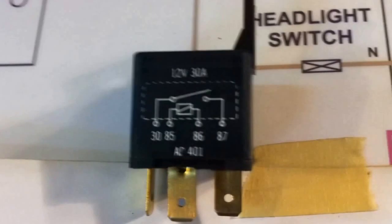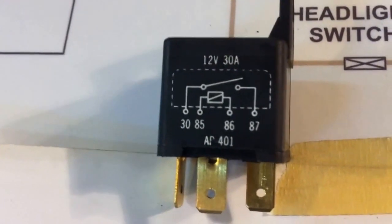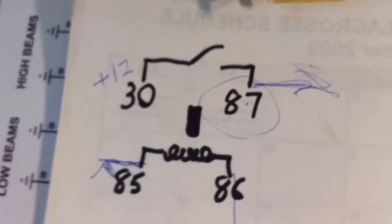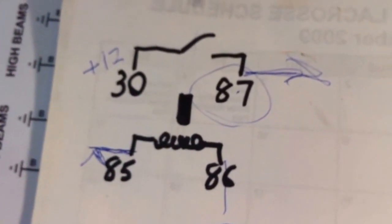Again, this is just a standard automotive relay, a single pole, single throw, and there's a bit of an updated or exploded diagram of it. So we've got the fuse box cleaned up. I'm quite pleased with that. All the connections actually are copper as opposed to just brown with dust. And so there's the two relays installed on that auxiliary panel.